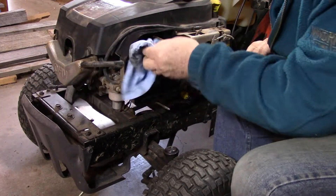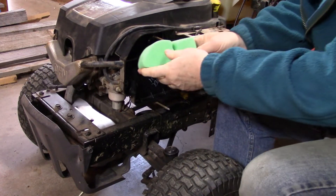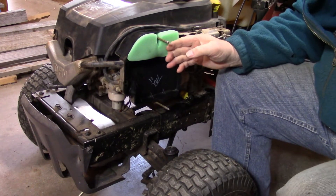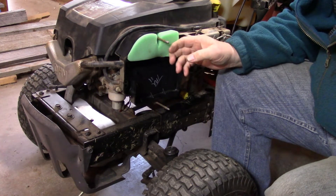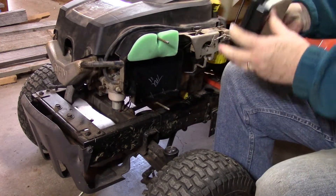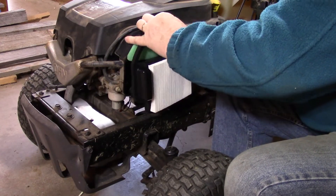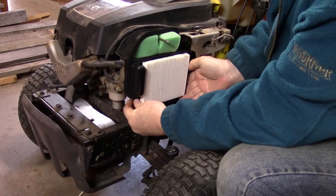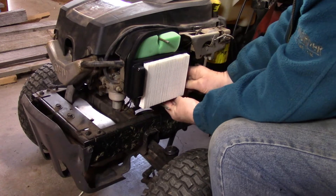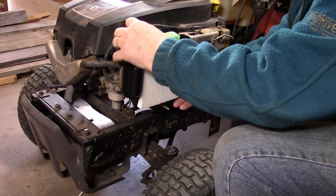For the air filter, I'm just going to clean out around the air filter box and then put the pre-filter in. Sometimes sponge pre-filters like this suggest you put a little drip of oil on them, but it doesn't recommend it here so we won't do that. Then the air filter itself — there's a recess on the rubber perimeter ring that goes around the housing. There we go, I think that's it.